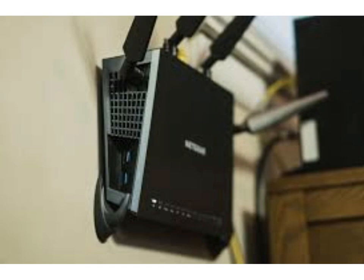As long as the router is plugged into a power source, the router should immediately light up. Give your modem and router a few minutes to boot up before attempting to connect to Wi-Fi. You can also connect your computer directly to your modem via Ethernet if you have an Ethernet port-enabled computer, for example, a PC or Ethernet adapter for most Macs.